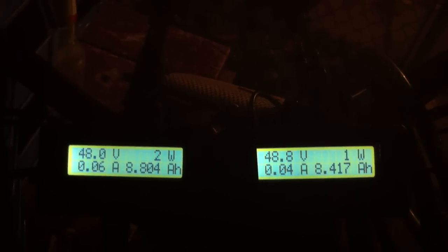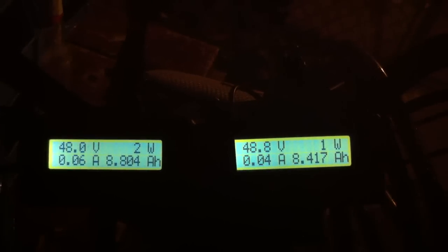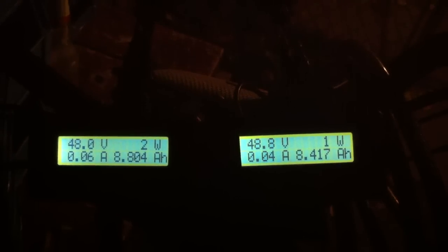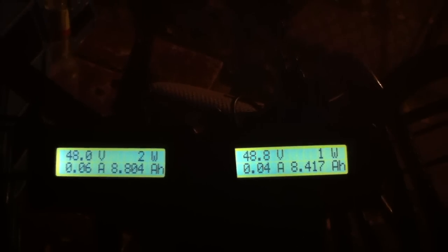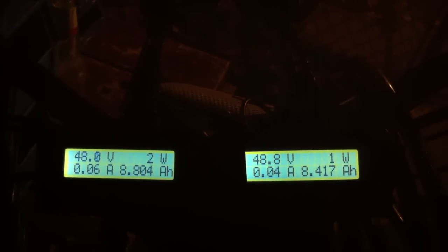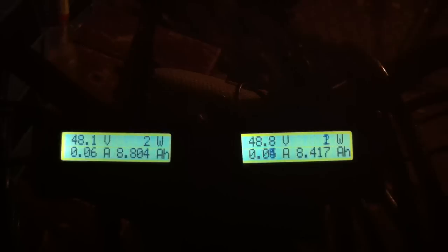As you can see, they both burn pretty much the same amount of amps in total. Because when I was going uphill for 10 miles, slight grade uphill, the left one was burning about 2 to 3 amps more than the right one. Then on the return trip going downhill, the right one was burning about 1 to 2 amps more than the left one, and it eventually caught up. On cruise control they both burn about the same, but at full throttle uphill the one on the left burns more, and at full throttle downhill the one on the right burns more.